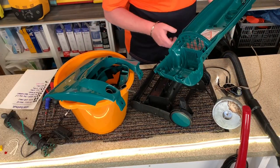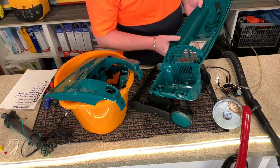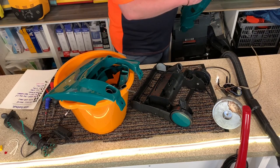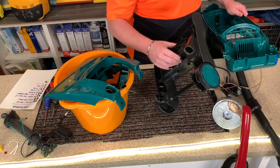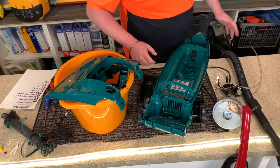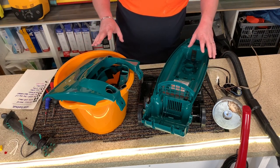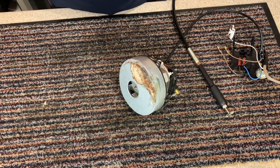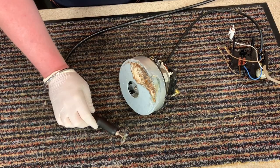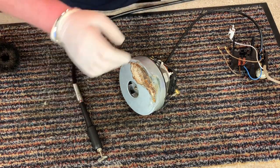All of the parts are now completely clean, I just need to wait for them to dry. I've cleaned up everything, all the mouse remnants. I put Dettol in the bath while I was washing the parts, so that would have got rid of any bacteria. Everything - the base, the hose, the lot - is all nice and clean. I just have to wait for these parts to dry. Next we are going to be sorting out the motor. I've got my disposable gloves and my mask, and I've got the Dremel all set up so I can Dremel the rust off and I'll use a vacuum to suck up while I do it.